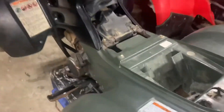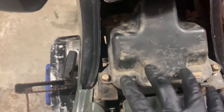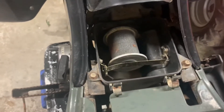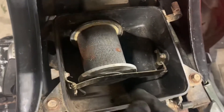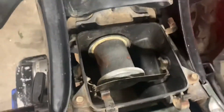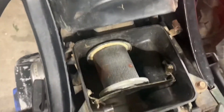First thing we're gonna do is take the seat off. Once you've got the seat off, you're gonna undo these clamps - two here, one there, and one there - and then this box should lift straight off. Once you get that box off, yours may or may not have foam around this core, but ours does not. So we're gonna pull this core out and put that new foam around it. It's a little hard to do one-handed, so I'm gonna undo this strap right here and pop this out.